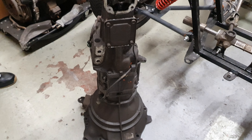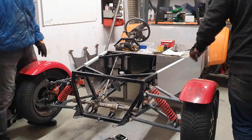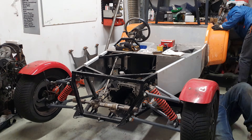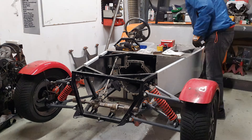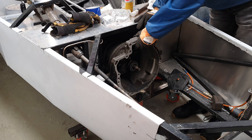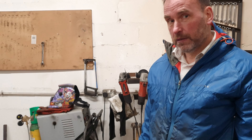What we're doing here is, A, testing the jig to see if it's going to allow the clearance for this gearbox to go in, but B, dry-fitting the gearbox on its own - no prop, no engine, just the box - because what I need to do is run the fuel line, but it's getting congested under there. I want to make sure I've got the clearance when the box is in to get the fuel line by without it contacting, and of course without an engine and a diff and everything else in the road.